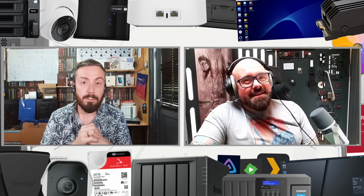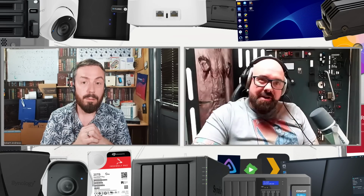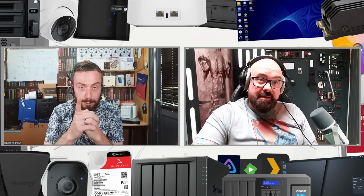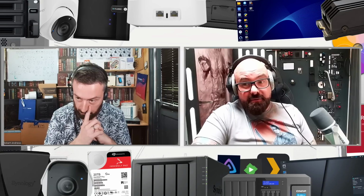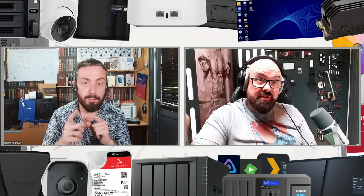I know what you're going to say. You're going to say, yeah, but because it's not striped across all of the drives, the speed is going to be slower. Which is quite true. On that array, it would be slower because the read and write is basically going to only one disk at a time.